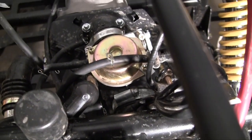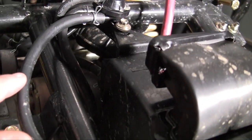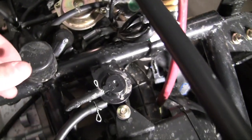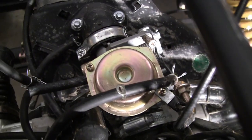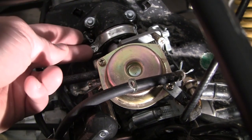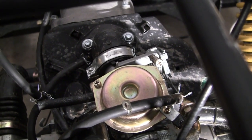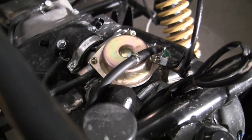There are a bunch of different places on your engine where harmful vapors are created or aren't supposed to be. What this system does is reroute all of the gas vapors — takes them from where they're not supposed to be and reroutes them back into the area where they can burn again. It takes all the vapors and puts them back into the engine so they can re-burn, preventing vapors from going into the atmosphere and preventing you from wasting more money on gas.